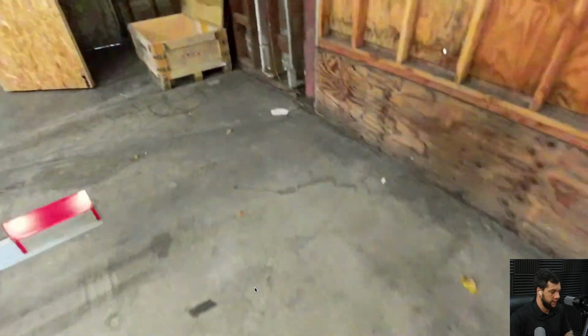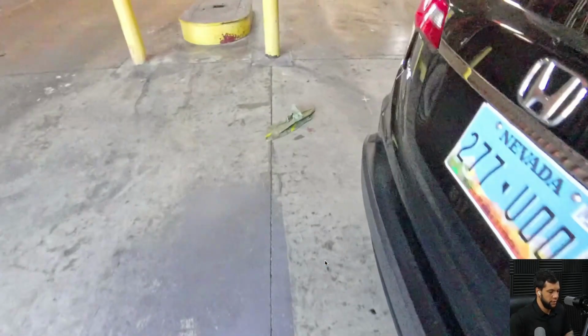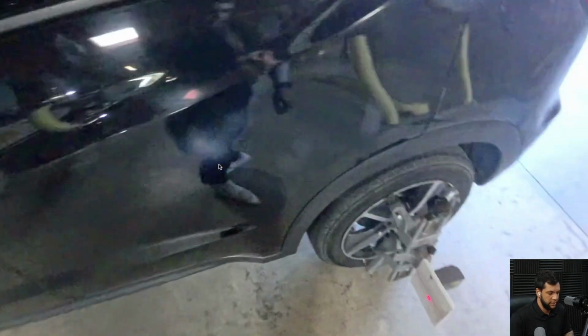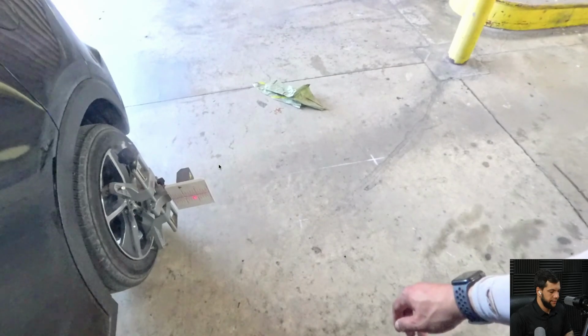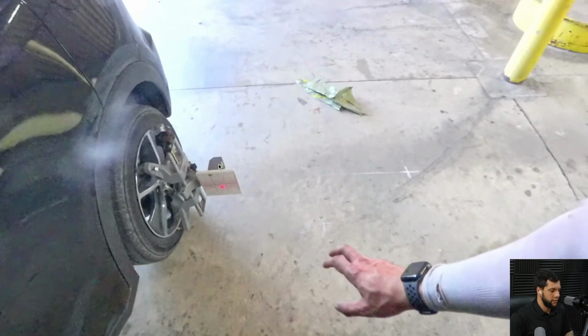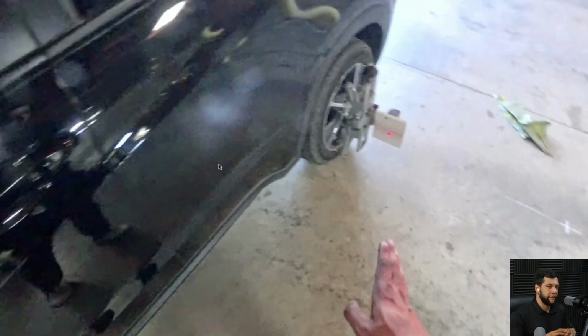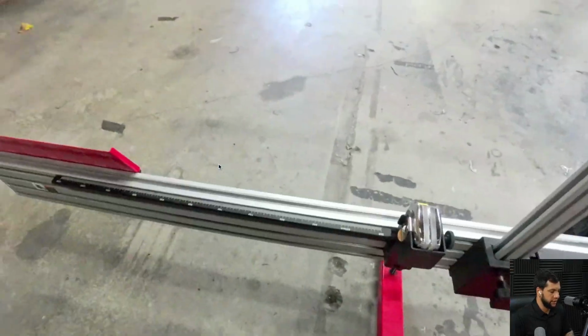All right. So now I'm going to move the bolts in order to get the right angle until you reach the value I'm looking for. So on the other side, I got between 8.5 and 9. And in this side, so here we are around between 8.5 and 8. So I wasn't very happy with this value, so I just move it a little bit to the other side. So I'll move it back, and then I'm gonna read the values again, okay?